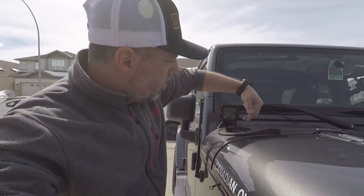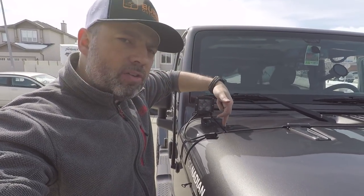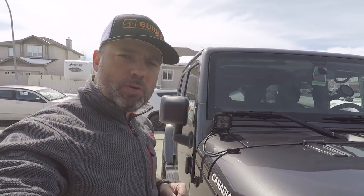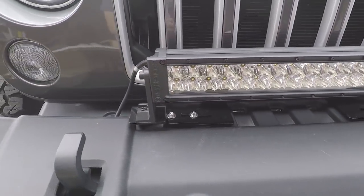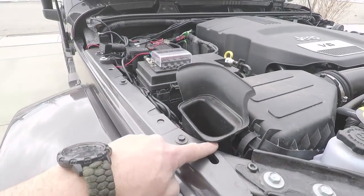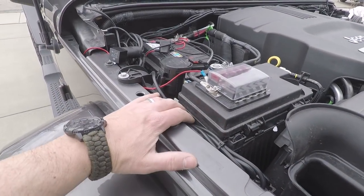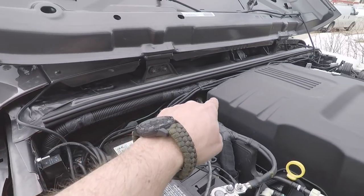That's a nice clean install. Now I'm going to pass this wire — I'll have to loosen these two here to lift the panel up and just pass that wire underneath for a nice clean, tight look. Do the other side and we've got everything wired in, then we're going to do the switches on the inside. Everything's wired up now — this ended up being a really nice clean install. The wire is running nice and snug underneath, coming in through here, all the excess wire is zip-tied together. I've got the grounds and the fuses all here with everything running out on the other side.